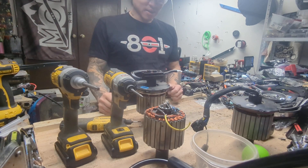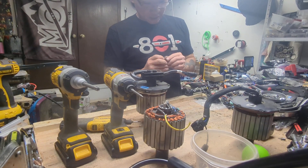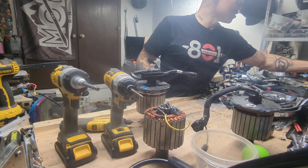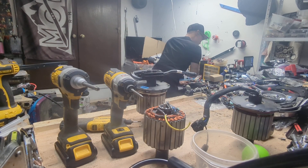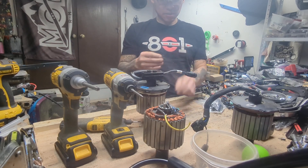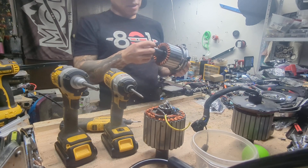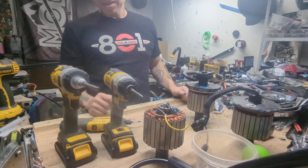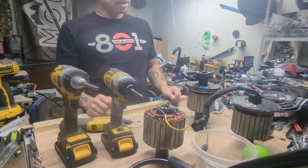Just in case you're wondering, the GTS does appear to have a slightly thicker o-ring than the XR, but it is also thinner than the GT. So I guess they listened — that's really the only thing I could say about it. Here's your GT and your XR o-ring, and here is your GTS. It does have a different o-ring, a different axle thickness, and a different o-ring groove. Which means we have to run a new model with new data on this, because that's actually really good news for everybody listening.